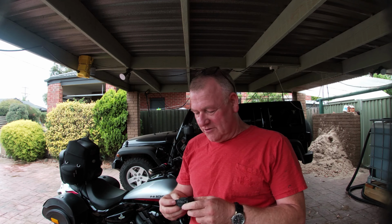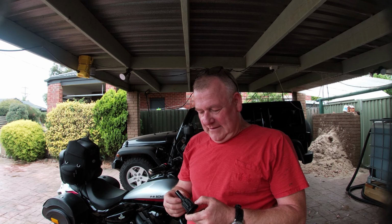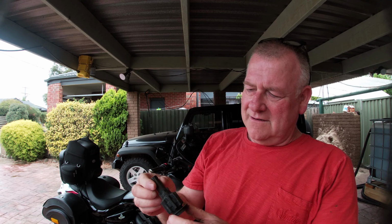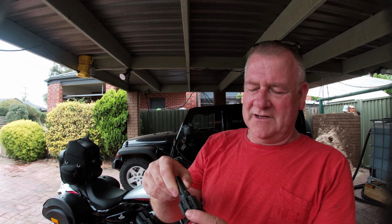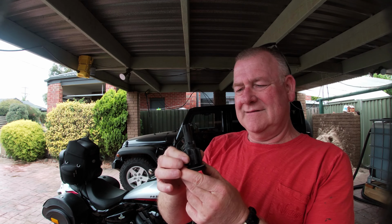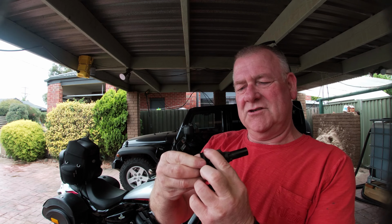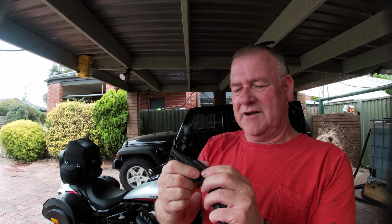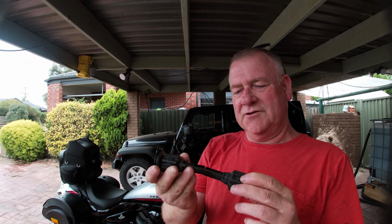Hi, today we're going to do the engine mountings on the Boulevard. It's the 1800 or M109R, VZ 1800, whatever you want to call it, both. And this is the engine mounts, this is what they're like. It's a steel pin, steel plate and rubber here which goes into the engine. And this cushions the vibration and everything. So there's two, it's the front ones I'm going to do.